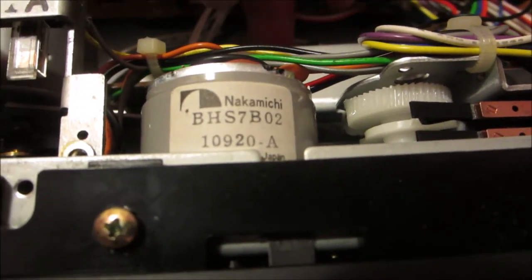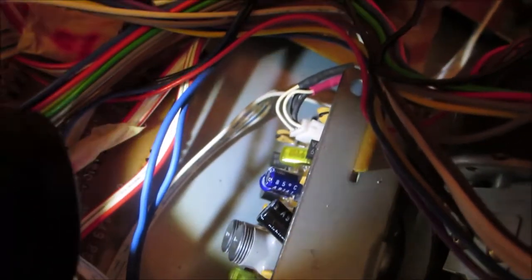I was able to mount the belt on the capstan motor — you can see it right there, it's already in place. Now I just have to put back all the screws. You can also remove this board — there's another screw at the bottom. If you have no sound on one side, usually it's one of these caps that's bad. I changed them — those purple or blue ones right there go bad. I put in regular caps and it works well; you can use regular caps like that and it works fine.